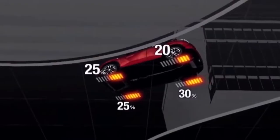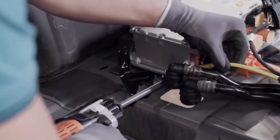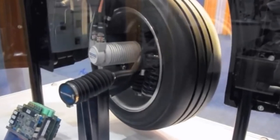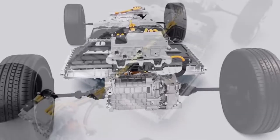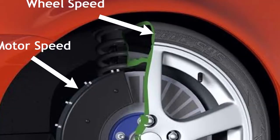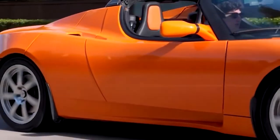Each wheel can be equipped with sensors to determine how much torque is needed at any given time. Similar systems exist in cars today, but response times are slightly slower due to the number of components involved and more complex electrical communication pathways. On an automobile equipped with in-wheel electric motors, various main systems are lodged within the wheel itself, meaning the engine, clutch, transmission, suspension, and other relevant parts can be eliminated. This substitution of mechanical functions with electrical methods is frequently referred to as by-wire technology — for example, drive-by-wire, brake-by-wire, etc. Removing the engine also makes it possible to expand design and structural enhancements to an automobile.